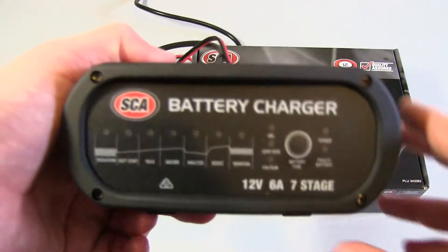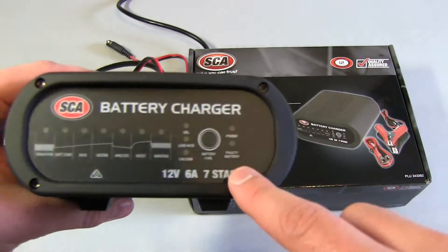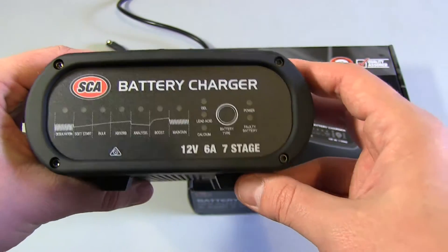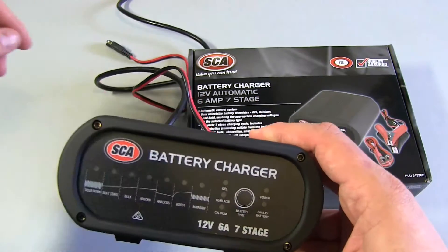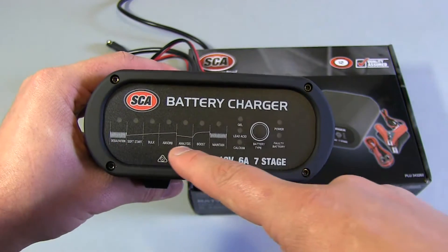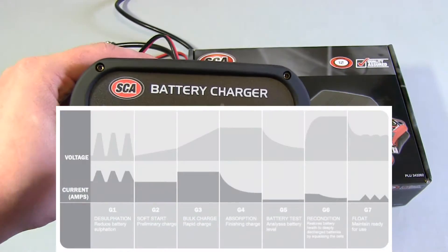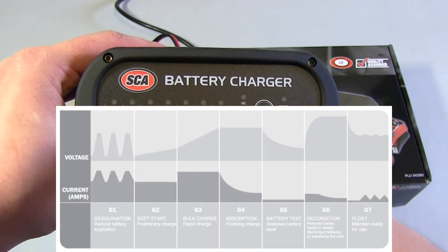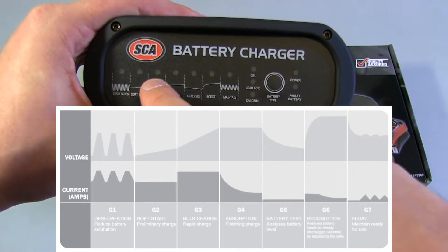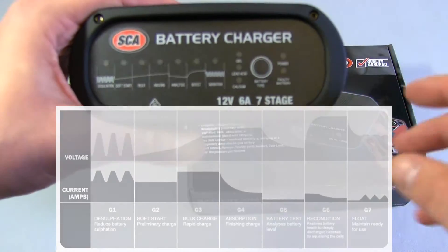The reason why this may be interesting is because this is a smart charger. Apparently it's fully automatic, so there's only one button on it, and the button is basically to choose what type of battery you have between gel, lead-acid, or a calcium battery. As soon as you put the alligator clips on the battery, it immediately starts its charge cycle. It's automated — seven stages that it goes through. I'll put a graphic on the screen which shows what the voltage and current should do. As it charges, it steps through with an LED for each stage until at the end it either tells you your battery is good to go, or if it finds a fault it'll give you a fault light.